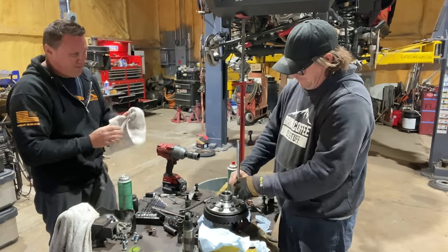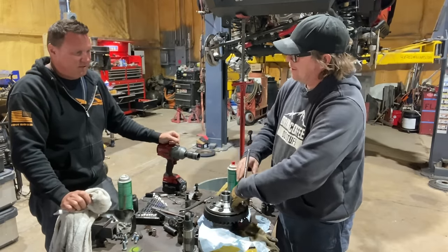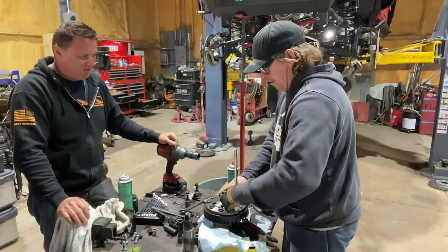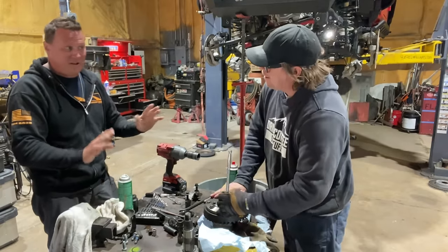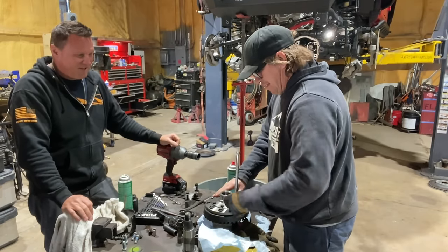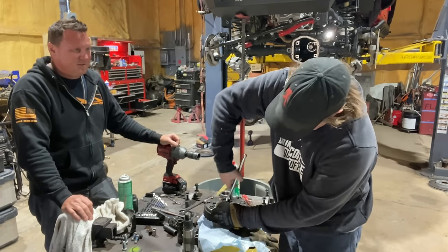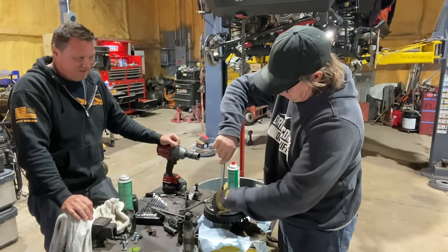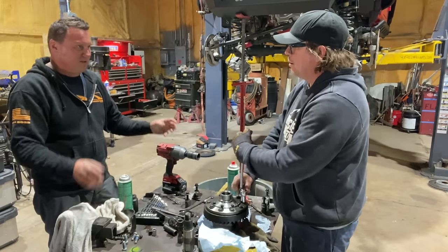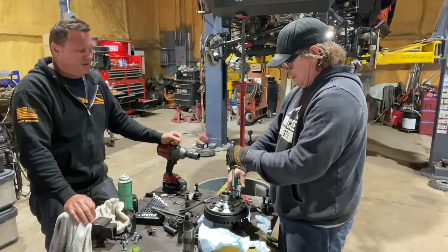I just took the strap for half of the Rubicon over the summer because I had a Detroit locker in there that all the bolts came out and just spun the case like crazy. And it made a little tink, tink, which means they were all out except for that last one. And I don't blame them on that. I'm pretty sure it's my TJ with a massive vibration, and just over time it backed all the bolts out of it. And I couldn't find one, it actually broke all the bolts. So I think they all came loose and then eventually broke them all, and they were just breaking one at a time. But I didn't find any of them.